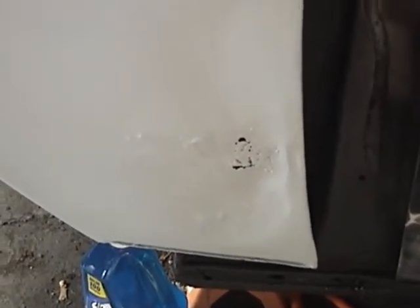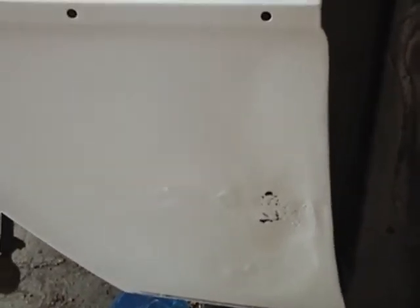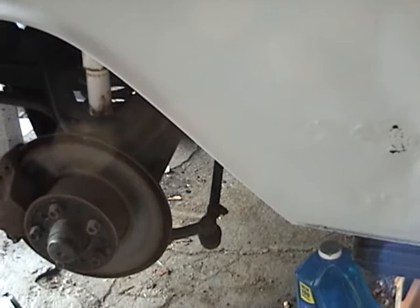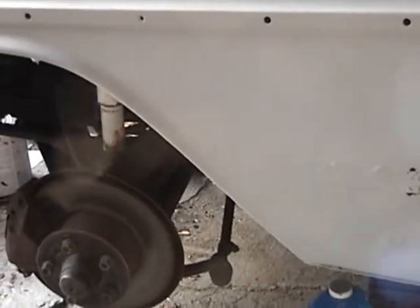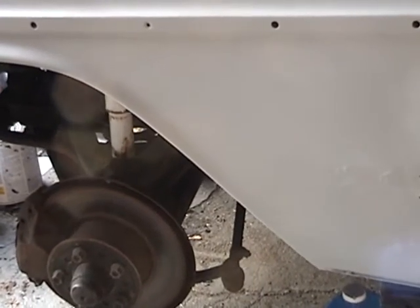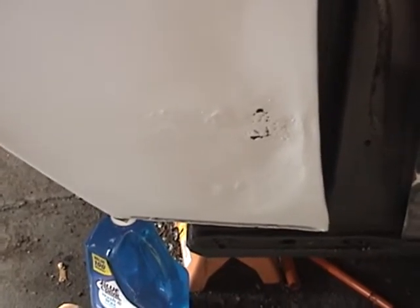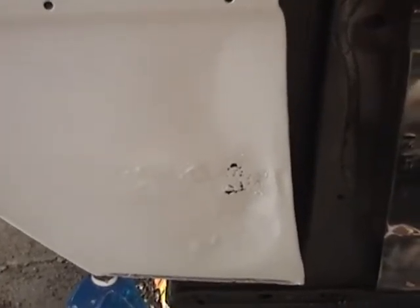So I'm going to fiberglass over that, then throw some Bondo at it — I might get to that tomorrow — and smooth it out, throw some coating on the back, and bolt the fender back to the car. I'm undecided as to whether or not I'm actually going to shoot paint at it. I may just get the inside edge of it, just so it's protected, but I also may hold off painting until I get the whole car ready for it, which is not going to be for a long time. The dented area here is certainly not perfect, you can still see it's dented up, and I probably even caused a little bit of warping with all the welding I did, but I'm not too worried about that. All in all, it was a good learning experience, and I'll certainly have better results even the next time I use the welder.